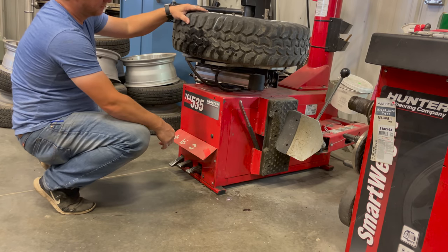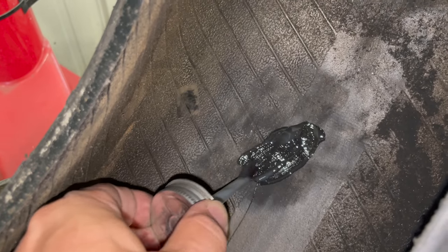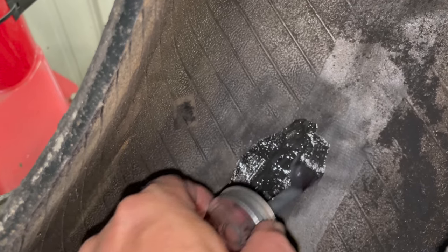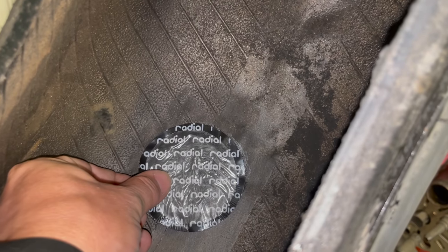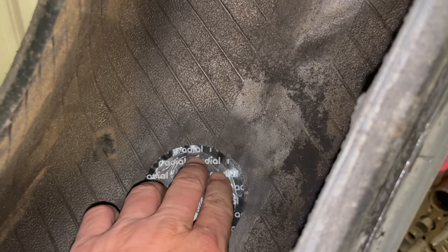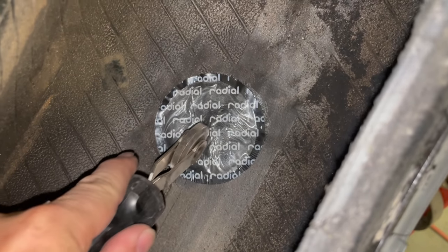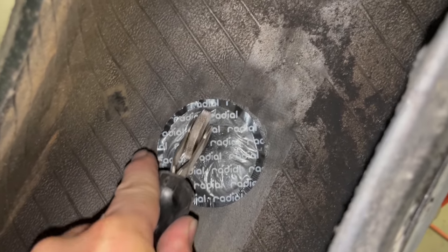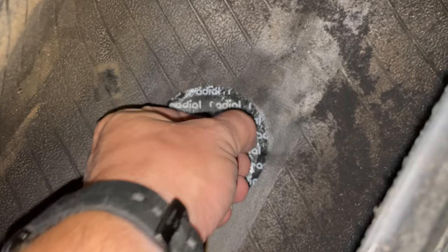I have to think of another strategy for this one. On the inside of the tire, I can see the damage I'll need to patch. I have the area buffed and I'm putting on some vulcanizing cement — applying that liberally — and I'll let this dry before I put the patch on. Now that the cement is dry, I'm placing the patch over it and pressing it on. I'm taking my stitching tool and, starting from the center working my way out, I'm stitching that into the tire. The patch feels good and stuck — now I can pull the plastic off.